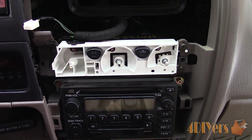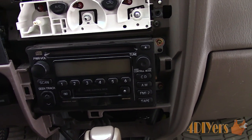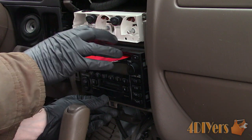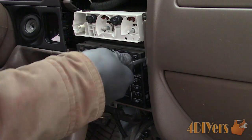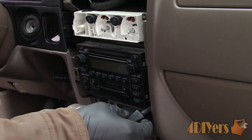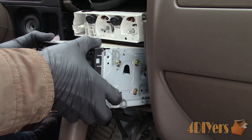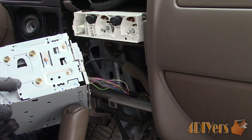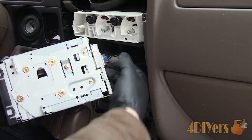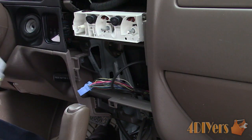Here's a view of the back side — you can see two mounting points for the Phillips screws around the HVAC panel, two snap clips at the top, two more on each side around the radio, one snap clip under the radio, another below the cigarette lighter, and one screw below the ashtray. There are four 8mm bolts holding in the radio. Make sure you remove any CD from the radio before disconnecting as you won't be able to retrieve it after. Remove the four 8mm bolts — two on each side — and pull the radio straight out. Pull out the antenna wire; it just slides into place. The electrical connector on the rear comes out in two pieces with tabs which are depressed — unclip and remove.